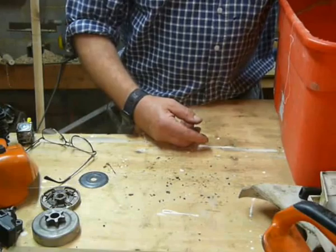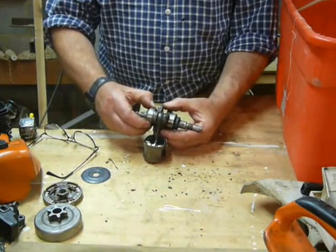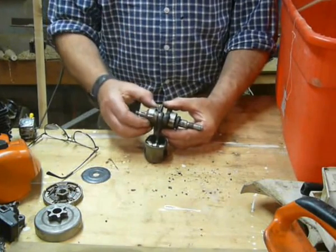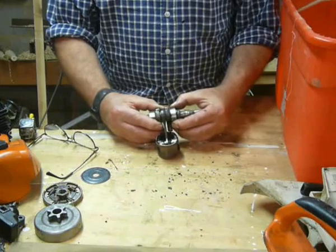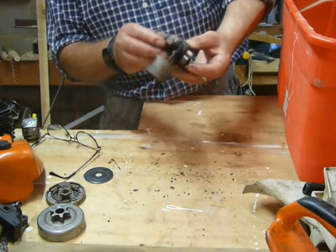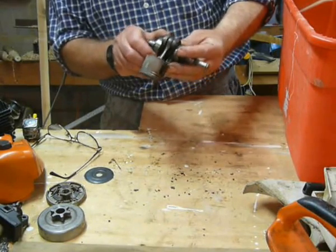So we're looking quite good so far. Here's the crank with the bearings. There's a bit of side-to-side rock. One might replace those. The seals don't look bad, but you can't really tell unless they're incredibly worn.